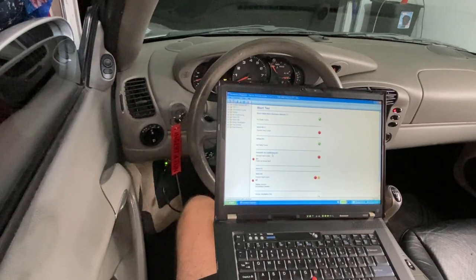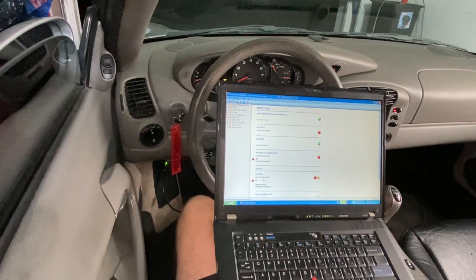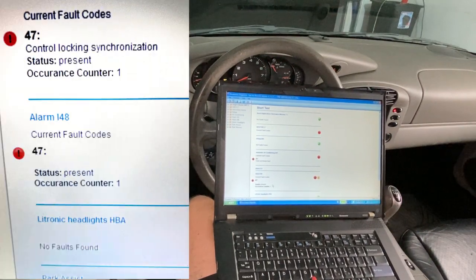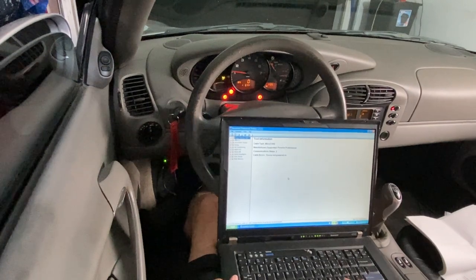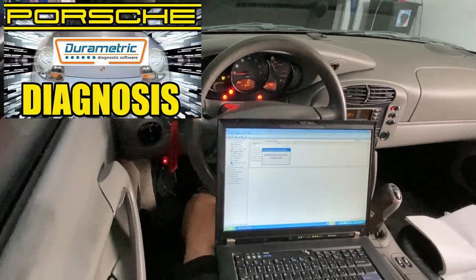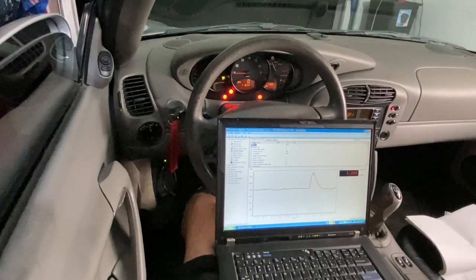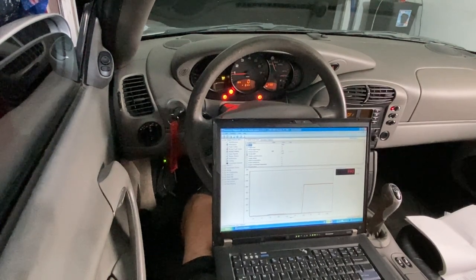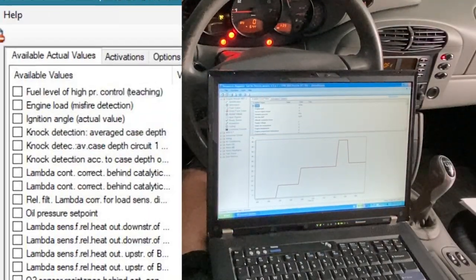Before we take the engine out, I want to see if there is anything juicy that maybe we should fix when the engine is out. The quick scan came back with no fault codes relating to the engine, a couple of codes relating to the central locking synchronization, and another one about the blower fan that we kind of already knew about. Next, I'm going to find the actual values section that we went over with Stacy in episode 54. There we go — it's actually talking real-time to the car. You click a checkbox and it will bring whatever you've selected up as a real-time graph on the screen. I was just taking a look at the mass airflow sensor output.